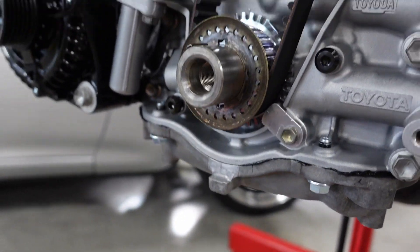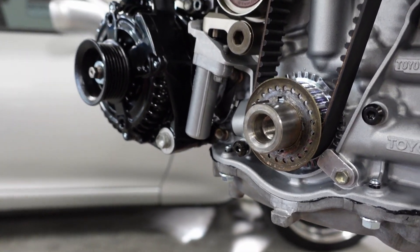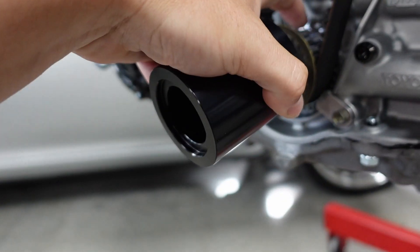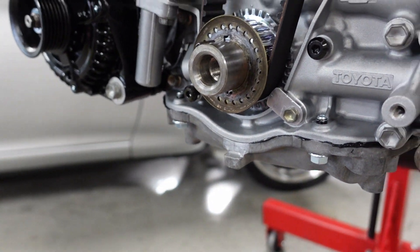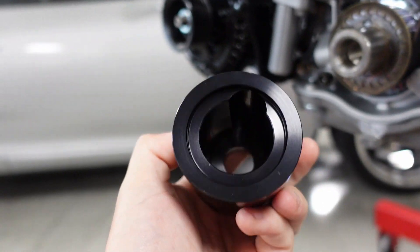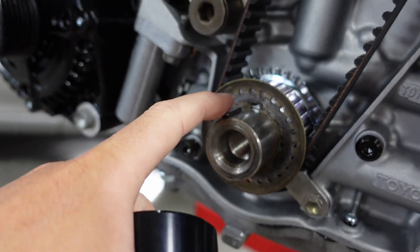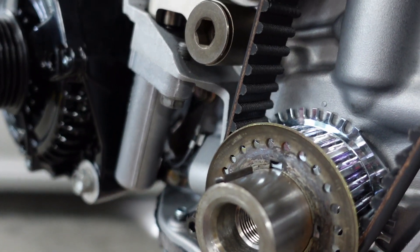Unfortunately, because I don't have another engine here that I can use — I've already got mine mostly together — but this is used to push in your front main seal. If you didn't have the gear here, there's a seal that goes into the oil pump, which I showed you guys in one video. Now I usually do it outside of the car, but when you do it in the car and have to replace the seal, it's not easy to get seated in. Well, he makes this tool now. And if you see there on the front of the crank, it has a little keyway in it.